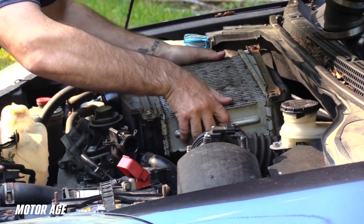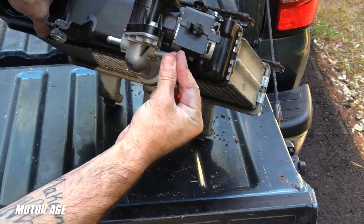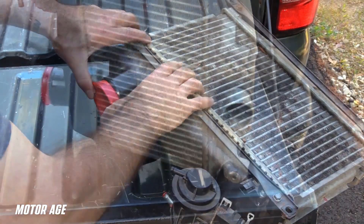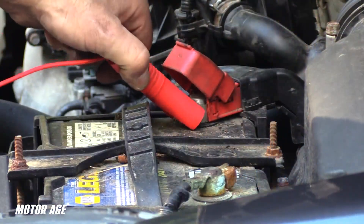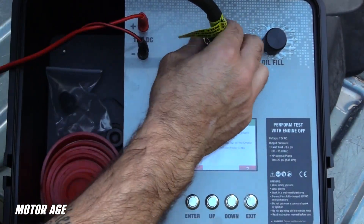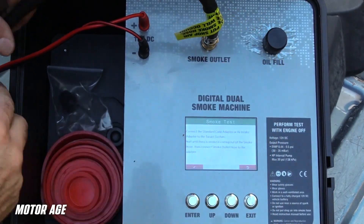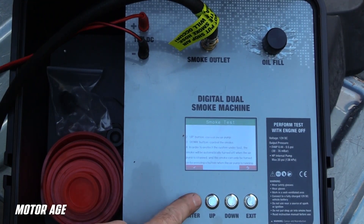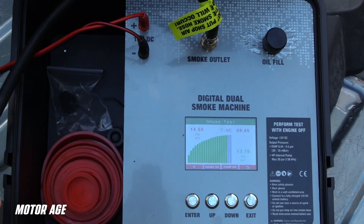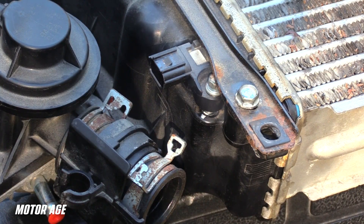Next comes component isolation. I removed the turbocharger intercooler and isolated it from the rest of the system — sealing it off from atmospheric pressure and introducing pressurized smoke. With the pressurized smoke machine running, actual pressure can be monitored using a digital scale. Since pressure is managed automatically by the machine, we don't have to worry about overcharging the system. Once pressure built to nearly 15 PSI — the normal operating conditions the engine would experience under heavy throttling — smoke could be seen leaving the port of the MAP sensor. Being able to visually locate a leak prior to disassembly is absolutely crucial to efficiency with cold side turbocharged system leak analysis.